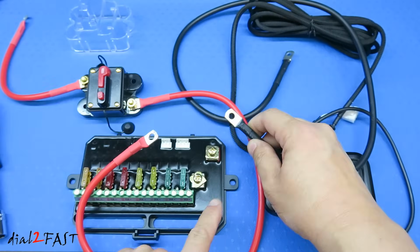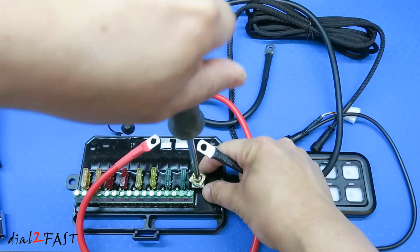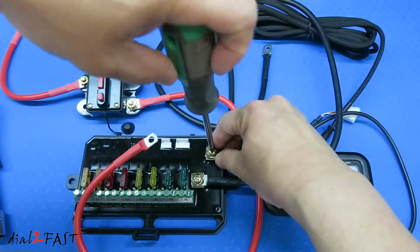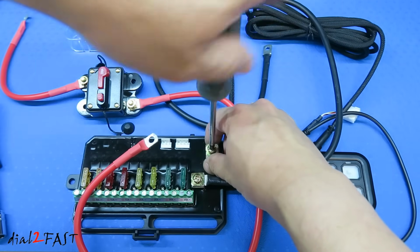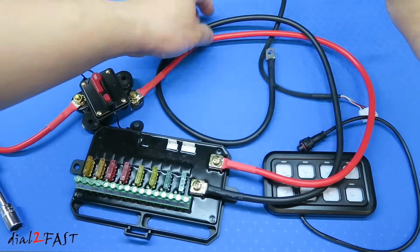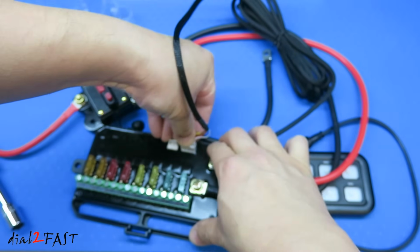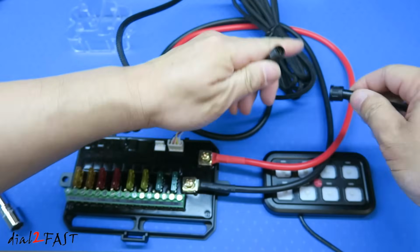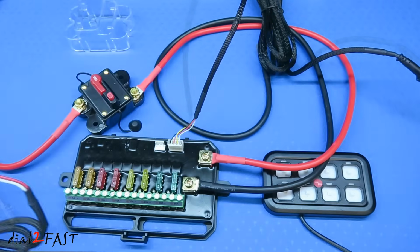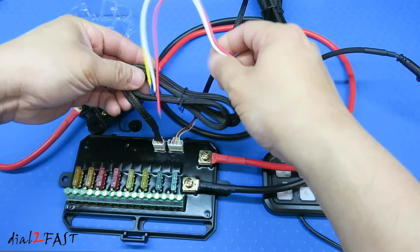On one end, you'll connect it to this switch controller box. This terminal right here is ground. And this terminal here is your 12 volt input. With this cable, connect this white connector to this connector right here. On the other end, you connect it to the controller. You also have this wiring harness. This is used for turning on the system and also controlling the brightness of the control panel.